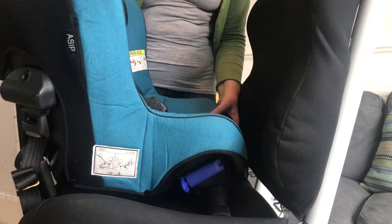The next question was how do you know if you've got the right recline angle and how do you know when you need the wedge? This is the wedge, which is an optional extra costing 15 pounds. It doesn't come with the seat because you don't need it in every car. In some cars the slope of the seat itself is much steeper than in others. If your car's got fairly flat seats you don't need the wedge, but in a car where your bottom is considerably lower than your knees when sitting down you do need it, because otherwise a rear-facing seat like this will be too upright.